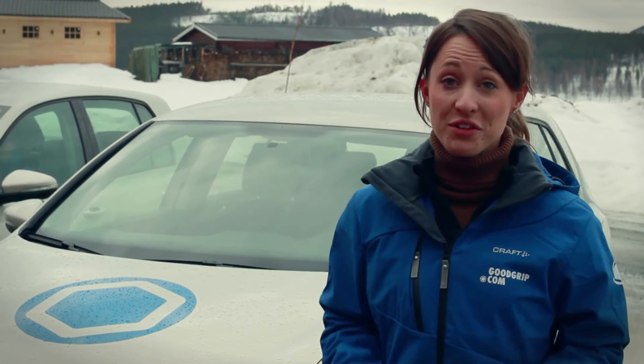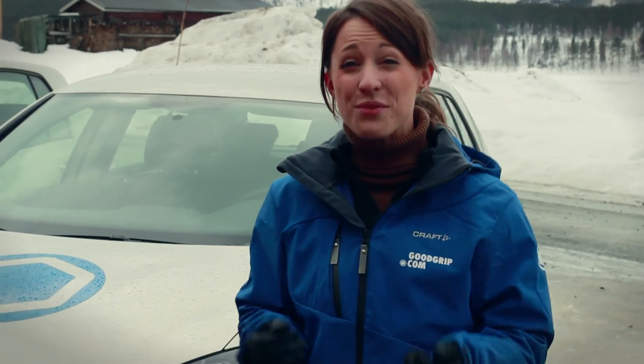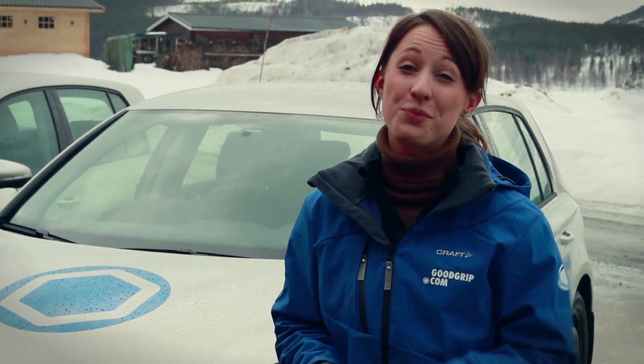As you can see from these tests, there is a clear distinction between summer and winter tires. Winter tires are the obvious safe choice — you have shorter stopping distances and better cornering. Remember, seven degrees Celsius is the magic number: when temperatures fall below that, put the flip-flops away, get the winter tires out, and you know you've made the safe choice for the colder winter months.